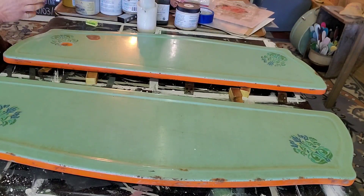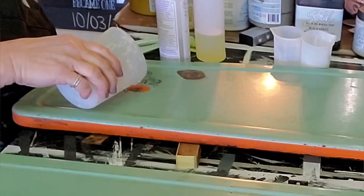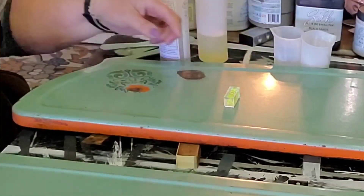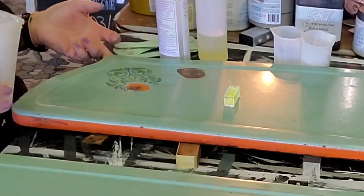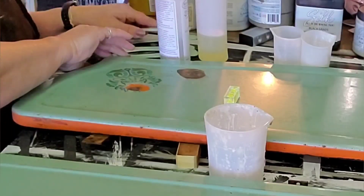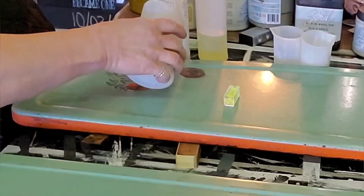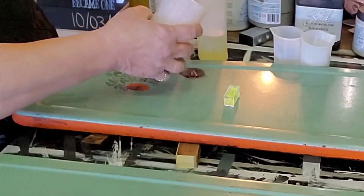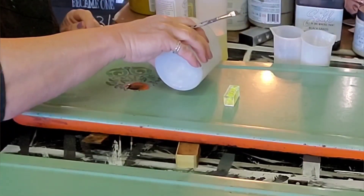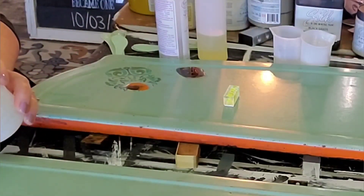I took those leaves off and I'm working on the surface. The enamel has holes in it that have rusted, so I'm using two-part epoxy — Amazing Casting Resin. I made sure the piece was level, but I see I need some adjustment. I'm using stirring spoons to get it leveled up and just pouring the epoxy to fill the holes. This is experimental, but so far it worked out pretty good. I used a paintbrush to feather it out to a smooth surface and intend to sand it back.